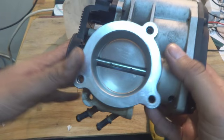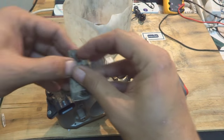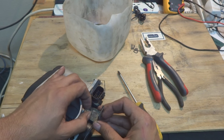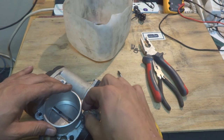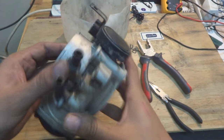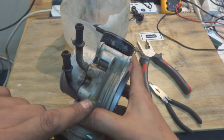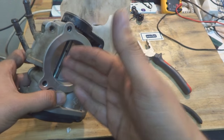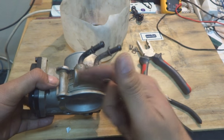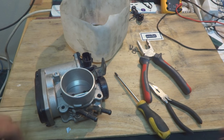So now this is our throttle body. Just one thing is required, the remaining part will go somewhere over here. This was just a cover for the cable, which it was holding over here. So just done. Later I will tighten it with the help of a socket. I also checked these lines, they are open for the coolant. It provides heat in this area, actually preheating the air going into the engine. This is just a preheating system and nothing else. So these lines are open and passing the coolant. I just checked it. I will install this part on the car now and we'll see the result.